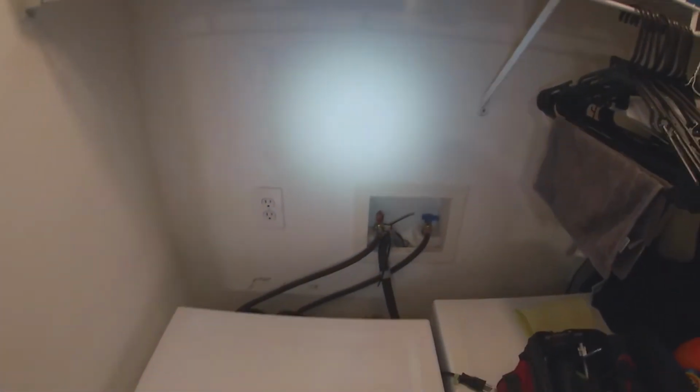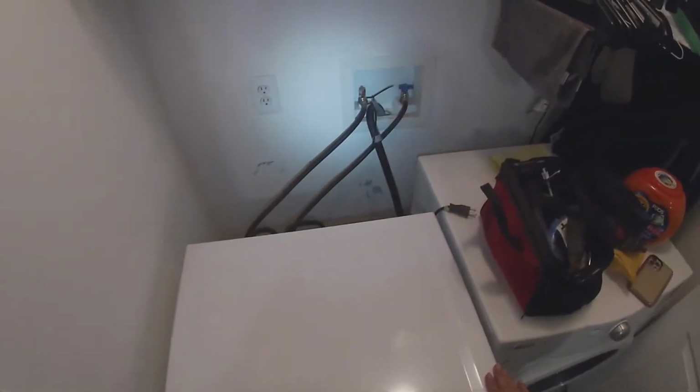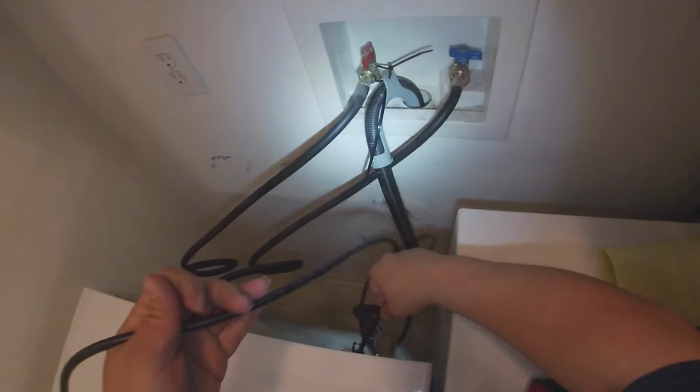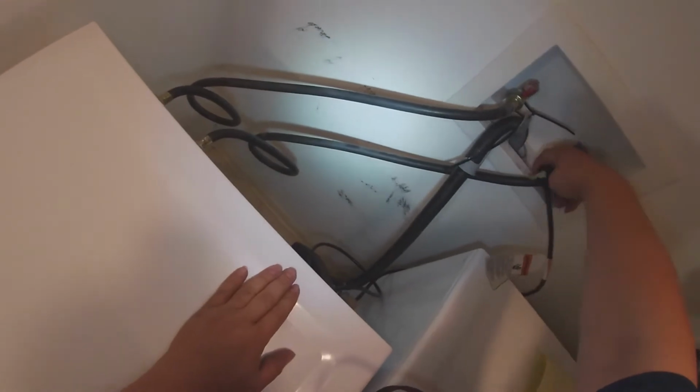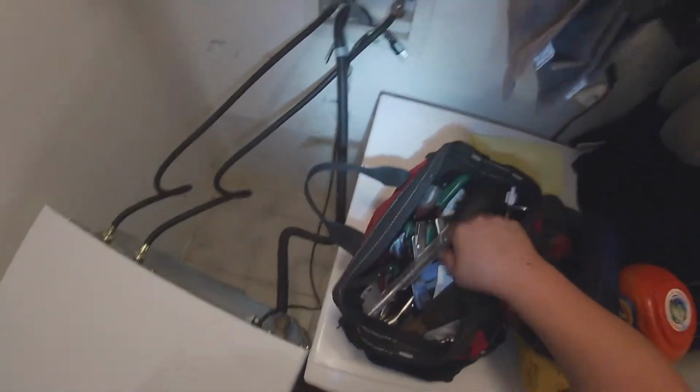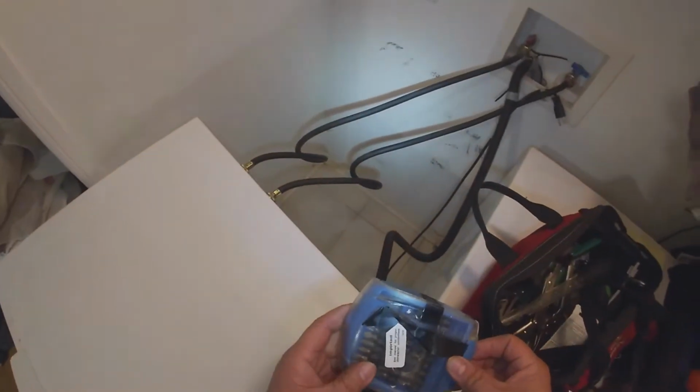We're gonna open the door and try to grab the washer from the door cabinet, and we're gonna disconnect the water hoses. Make sure the washer itself is disconnected from the power. I'm gonna secure this electric cord there, that way it doesn't go to the floor. Now we're gonna move the unit forward, that way we can have access to the back panel.